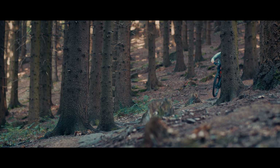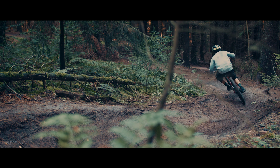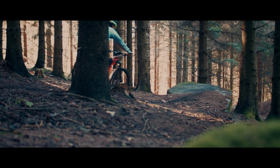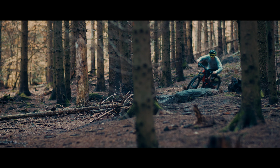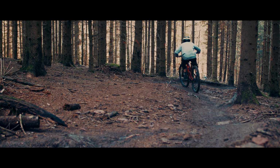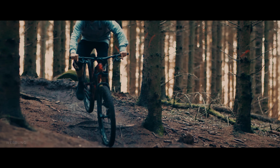At high speed the bike remains stable due to the long wheelbase. The RockShox Lyrik Select fork responds sensitively to even small bumps and delivers a high-end progression for hard impacts. The rear triangle reacts progressively and is designed to use both coil and air shocks. The 4-pivot kinematics damp small as well as large impacts precisely away and remain always high in the suspension travel. Unfortunately, the damper limits by insensitive response and does not follow in the case of fast successive impacts.